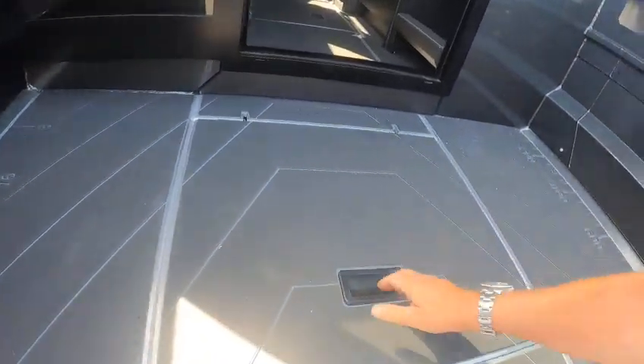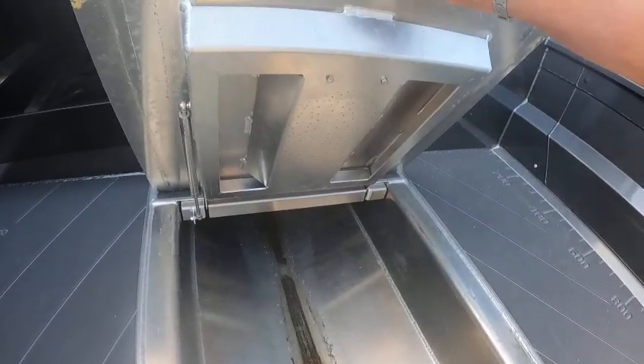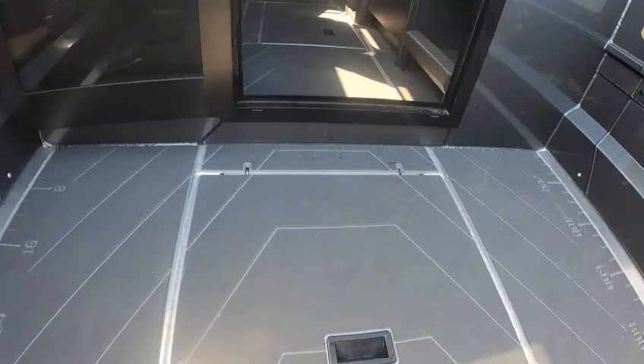You've got to remember this has got a plug right there. You always have to have that in, because if you pull it, water is going to come in — it goes straight down to the bottom of the boat. Again, this has got chambers plus the main bottom hull, and this is reinforced so you can step on it. It's virtually unsinkable — even if you forgot that plug and the thing filled up with water, you're just going to have water in there unless you carry a portable bilge pump with a hose and alligator clip to hook to your battery.